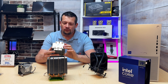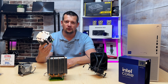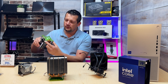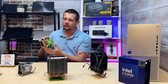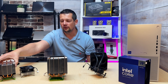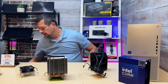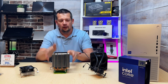When I looked into the tower cooler, I made a mistake. It was on eBay and listed as compatible with the XPS, costing around $20-$25. However, it's not. It only has six heat pipes and a significantly smaller cooler. The problem is the distance between the mounting screws is about a quarter inch shorter than the Dell Advanced Cooler — so this is for a previous generation. When I looked at the picture it looked nice, but it's not the real deal. If you're looking on eBay for a six copper pipe cooler, it's for a previous generation, not for the 8960. I'll be able to reuse it on an older Optiplex, which should actually be great.